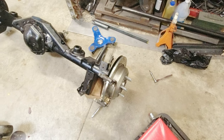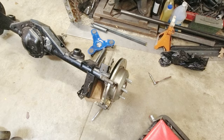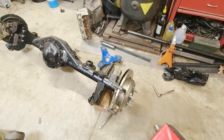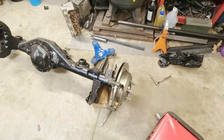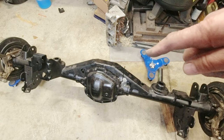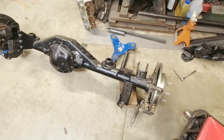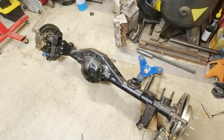So that's the basic assembly of a Dana 44 — pretty easy to assemble. You don't need a whole lot of tools to pull the axles out. In our other videos, we show turning the rotor upside down to pull the axle out if you need to. This is out of a 2018 JL Rubicon that we're going to put in our sport. Eventually this will go under our Jeep and we'll have videos for that. I'll put a link where we actually welded on the truss — it's a pretty easy install. Until then, I'll see you in the next build, whether it's in the garage, on the trail, or at a show. Enjoy this content and please remember to subscribe.